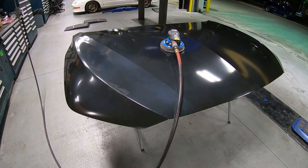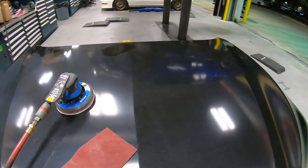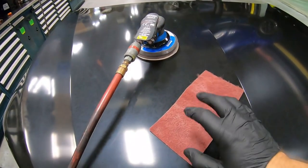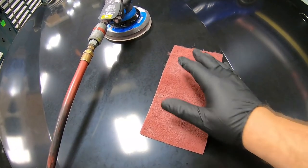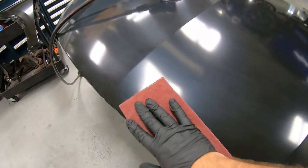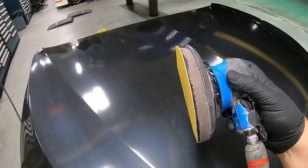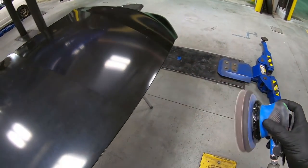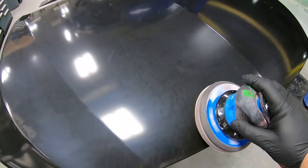However, I do like a little bit more bite — I don't like my paint to chip. And here at the dealership we need to make sure we warranty everything. I'm also going to use a maroon scuff pad, which is equivalent to around 400 grit, so we can use this for the areas around the edges that we just can't get to. Now, I don't like to run full blast — a lot of guys will go completely crazy — but the slower you go, the better the paper will cut.